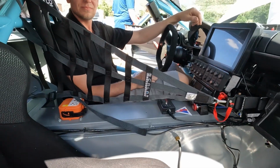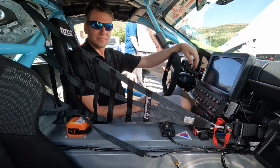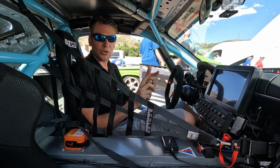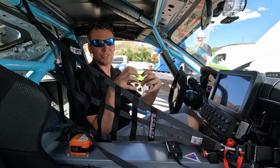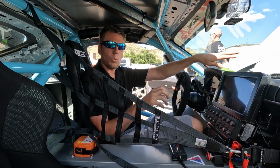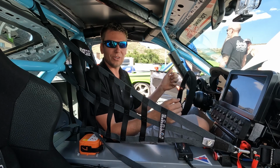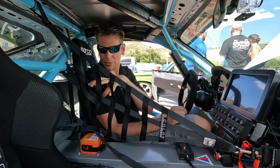Yeah. So another thing I notice is that the battery is really largely within the roll cage. So as far as preventing against a mechanical impact or something like that, that has to help too. Yep, that was very important to keep the battery weight centralized to the car, not only for crash protection, but also for weight and balance of the car. Keep the center of mass as close to between the axles as you can. As soon as you have weight overhanging an axle in the front, overhanging in the back, now you have leverage that weight can exhibit on the rest of the chassis when you go around a corner. You keep the weight inside the axles, the polar moment of the car is very central. So when you're driving it around a corner, it's very stable. Doesn't feel like it wants to slide out all the time. So crash protection and handling characteristics of the car was why we put it in the location that it is.